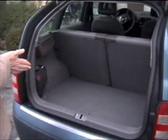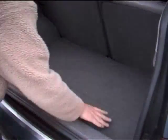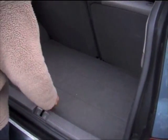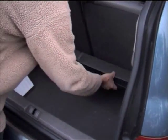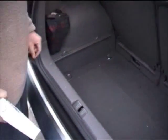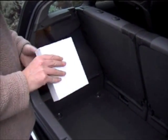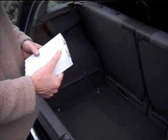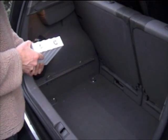Now the A2, we're pretty certain, was already designed with this kind of conversion in mind, because this is the kind of floor that you generally see when working with the A2. Due to the fact that this sill is a little bit higher, this floor comes up, and that actually comes out nice and easily. There's already this mini compartment where we intend to put our batteries. These are high power lithium cells — they're 50 amp hour each and 3.2 volt nominal.